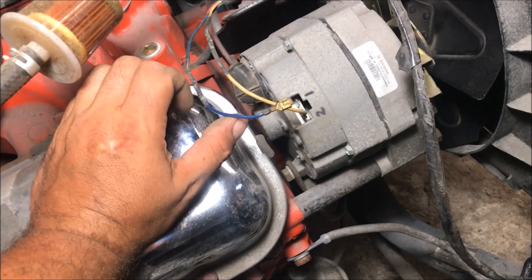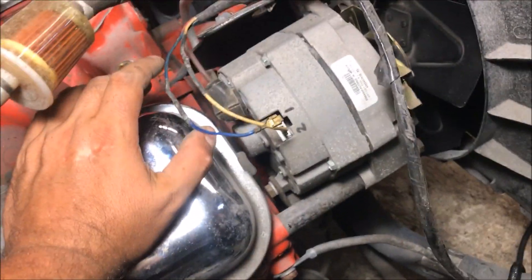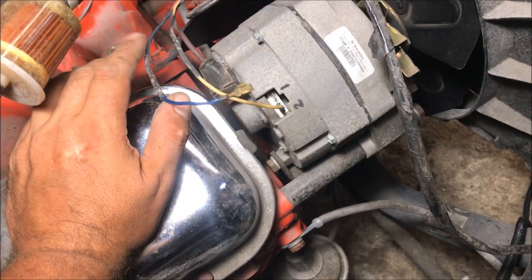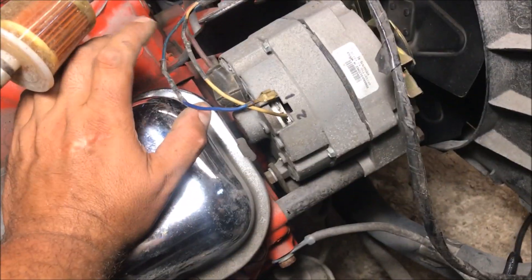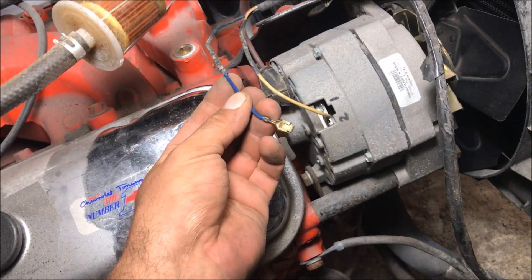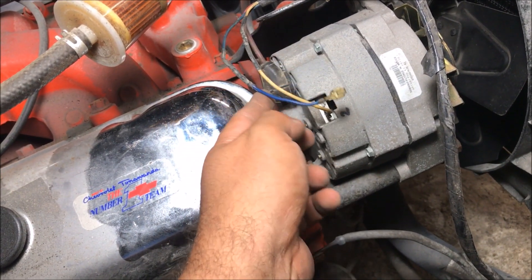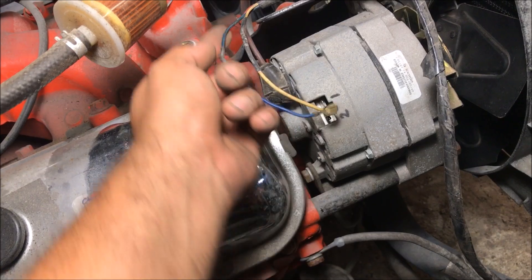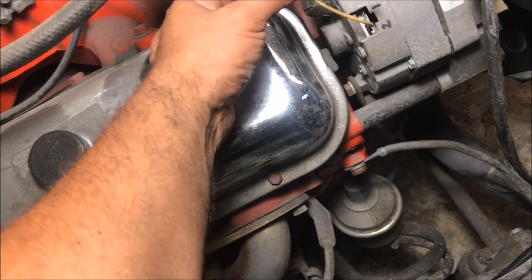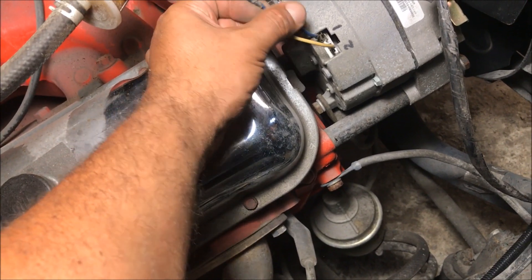But on this car the situation may have been messed with — it's wired on with the key instead of accessories, and what's happening is it's back-feeding through ignition back to our coil and keeping our car running. Now when I talk about the diode, I didn't really demonstrate wiring it in, so let's go ahead and wire the diode into my car.